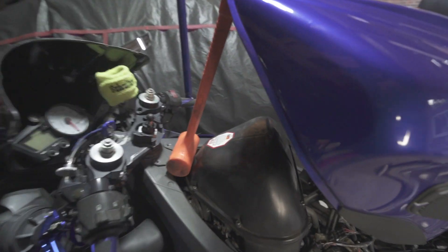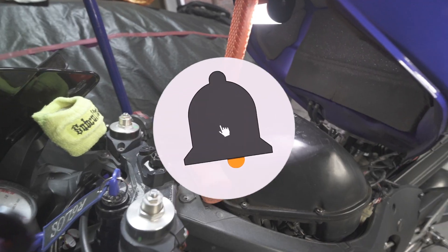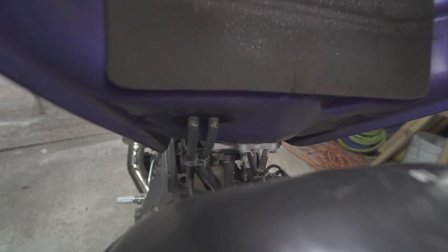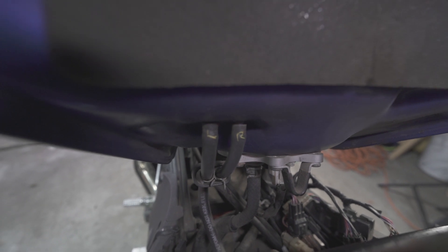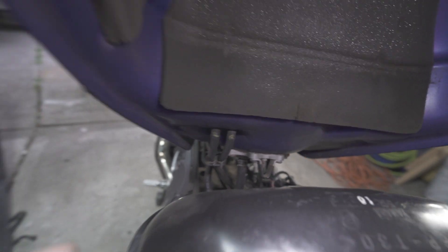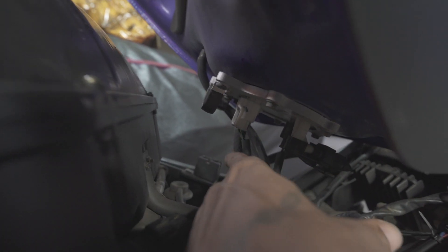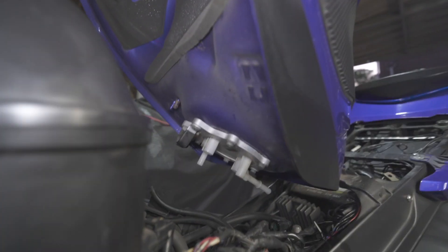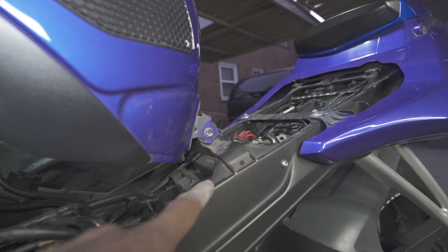About to disconnect this battery and pull the fuel tank off real quick just to get it out of my way. One thing I did was use a China marker to mark both of these hoses — left and right. Then disconnect those two hoses, plug here, plug here, disconnect this hose, and that's pretty much it. Everything down here is disconnected. Only thing left is this little 10 millimeter bolt — knock that out and then you get the gas tank off.